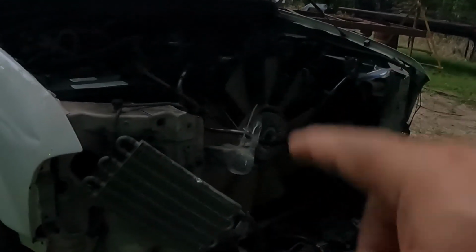As y'all can see, it's getting dark, but I wanted to let you know I got a fuel filter, put it in with the correct O-ring on the cap, and that tightened up, and cycling the key to prime the pump is not causing any leaks. So the only place it's leaking is probably from the little rubber boot that attaches the metal line to the back of the housing, or the ball valve itself is leaking.